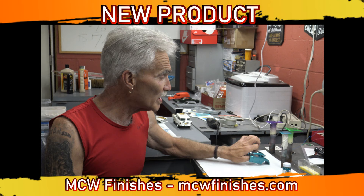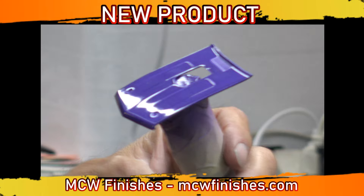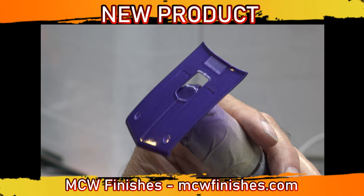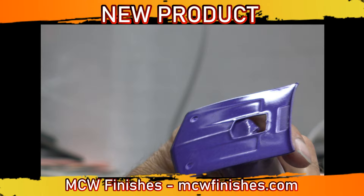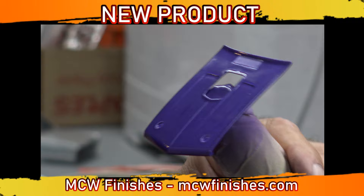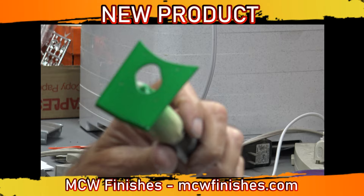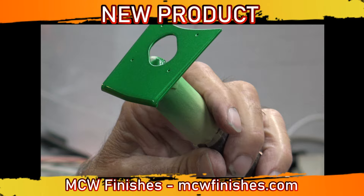This was shot using Mike's slow reducer at a 2 to 1 ratio. You'll have to excuse it — I was shooting more for product workability rather than cleanliness. As you can see, as always with enamel, out of the gun you've got a shine. You'll have this dried within 15 to 20 minutes using the Sunnyside Lacquer Thinner method. This was shot with the 2 to 1 method using the Sunnyside Lacquer Thinner. It's a little dry, but that's to be expected with metallics using lacquer thinner.